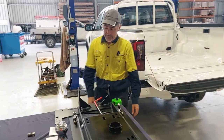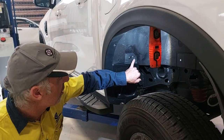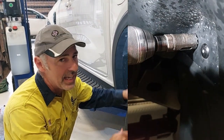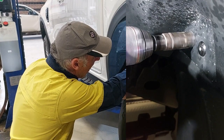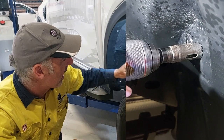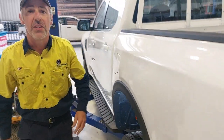You do have to remove the guards. The inner guards here have got to come out. There are two huck rivets in there and you can't get them out — too hard. So we use a 22mm hole saw, set that to drill with no pilot hole, and take the outers off the huck rivets, and then you'll be able to pull the guard out. Then we jack it up and start the install.